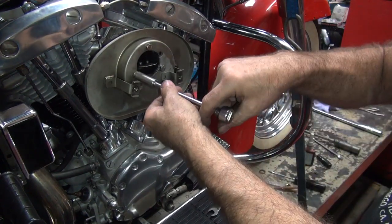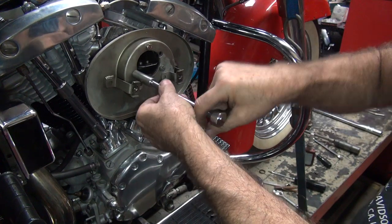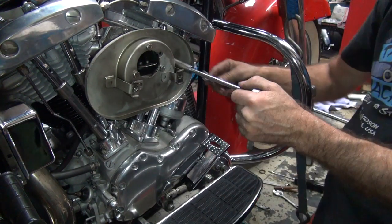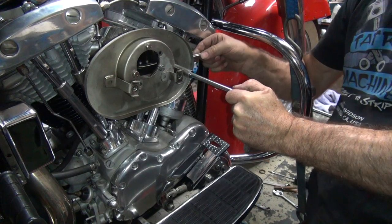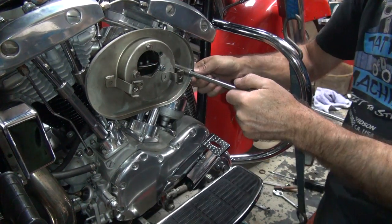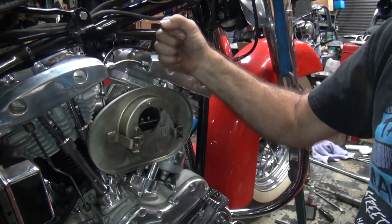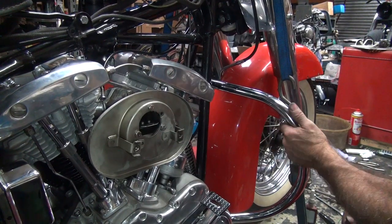Okay, over torque. If you over torque these, you'll probably break the carburetor. If you're lucky, you just strip it. Well, he put a gasket in there, which I don't usually use. That gives you some cush, which gives you a false feeling of tightness. This one you can tighten up pretty good. Yep, I don't mind torquing that one. Okay, when you're all done, it should be nice and solid. Yes, solid. See, solid sounds solid. You know, something's loose, sounds loose. Solid is solid. This is loose.